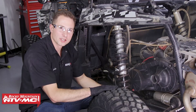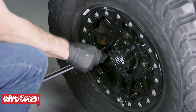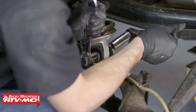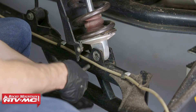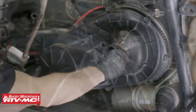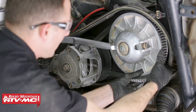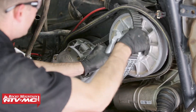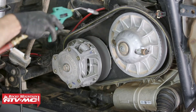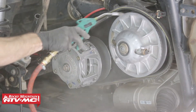At this point we need to gain access to our clutches. To do that, remove the rear wheel, remove the lower shock mounting bolt, and then remove the clutch cover. Next, remove the belt using the clutch sheave spreading tool — walk the belt off. If you're going to reuse this belt, note the orientation; ours was installed so you can read 'Polaris' on it, so install it that same way. The clutches have some dirt and clutch dust on them, so clean them out really well before going back together.